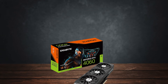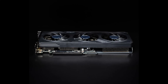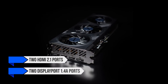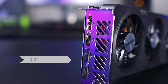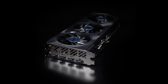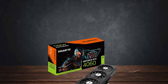In addition, the card also features dual BIOS, which can be helpful when performing any overclocks, thanks to the efficient cooling system in place. In terms of connectivity, you're looking at two HDMI 2.1 ports and two DisplayPort 1.4a ports. Some 4060s in the market feature a single HDMI 2.1 port and three DisplayPorts, so connectivity is something to keep in mind when buying a card. Nonetheless, it's not lacking any really important options here.